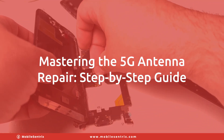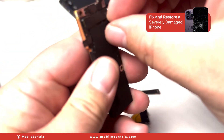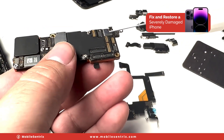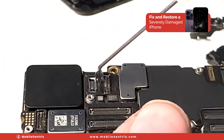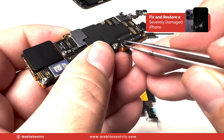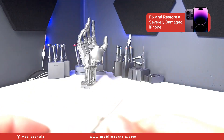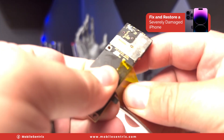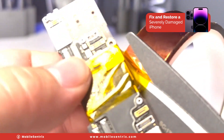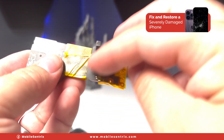What we'll do now is disconnect this, and because we have to work on the 5G antenna, I'm going to remove the sticker here on the back. Before we start to apply any heat, I'm gonna save these components by adding some isopropyl alcohol to them. This will loosen up the adhesive, allowing them to basically pull right off. That way when I'm done with all the heating, I can go put them back. To ensure that nothing happens to the motherboard when we're heating it up, I'm gonna go ahead and wrap it a couple times with some Kapton tape. This will keep things from shifting and splitting when I'm putting heat to the board. Let's go into the microscope and take this off.